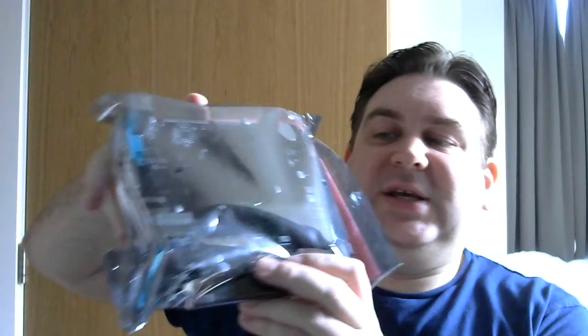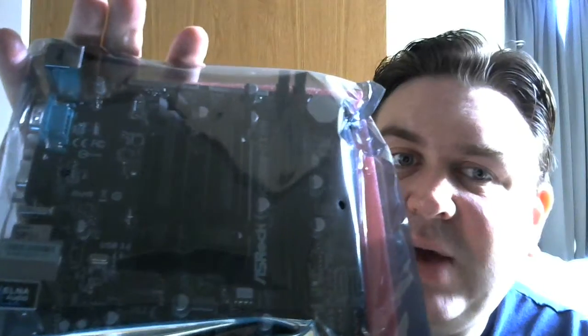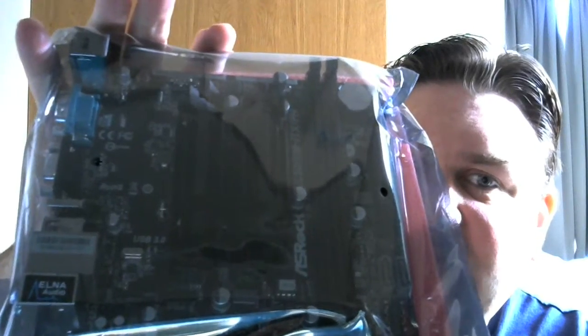I'll give you another look. This was a £60 board — remember that £60 buys you the processor, graphics card, sound card, ethernet card, and the board itself. When all these things are considered for such a specialist piece of hardware, I think it's a good price. I was looking at a VIA-based solution, but unfortunately they are at the very cheapest £220, which is absolutely ridiculous for such a low-power system. The processor might be slightly faster, but there's a trade-off with the graphics since they're still using S3 Chrome graphics, which I can't imagine have progressed at the same speed as AMD Radeon graphics.